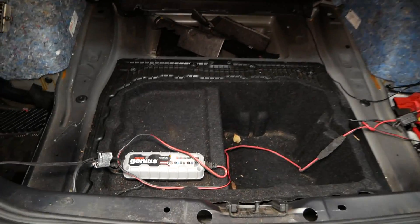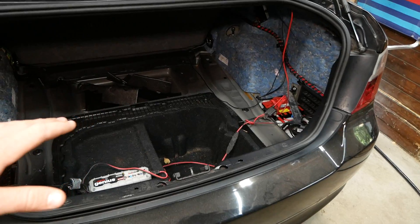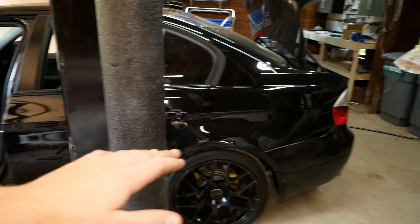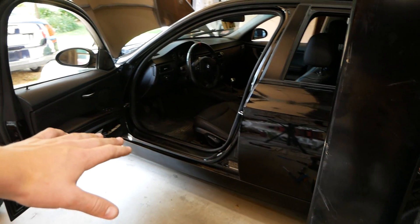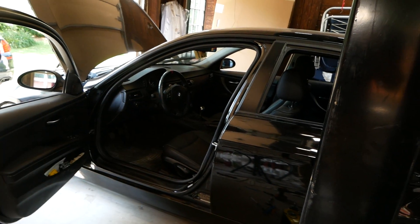Currently trickle charging the battery — just give it a bit of charge. Currently at 50% there. I think I'm going to let it charge up a bit more before I reconnect it and give this a shot, but I'll check back in once I do. I'm not 100% confident this could solve the problem — well, it very much could. I have a feeling it could be the junction box module.